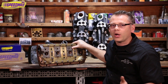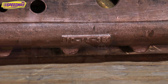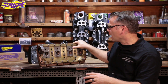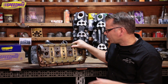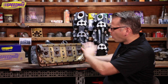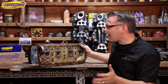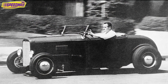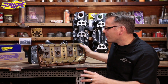They actually made two versions of the Thermal Flow heads over at Federal Mogul. This one has a foundry date on it of 1936. This is a 21-stud setup — not like the stuff behind me that's new out of the catalog; that's all 24-stud stuff. This would have been for maybe a '37 or an early '38 flathead engine. They've got all the casting and part numbers on them, and if you take all the bolts off you can see all the cooling passages. You may be familiar with the more common version of the Thermal Flow heads — all of these are super rare. A guy by the name of Bob McGee has probably the most well-known '32 Ford Roadster known for running a set of these heads. You just don't see them very often.